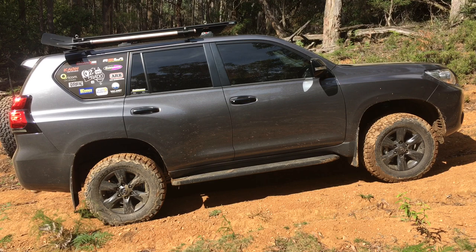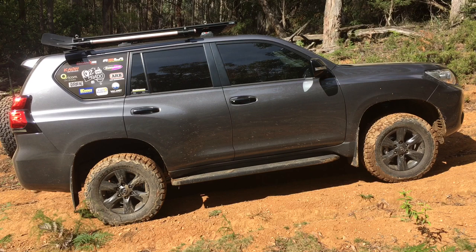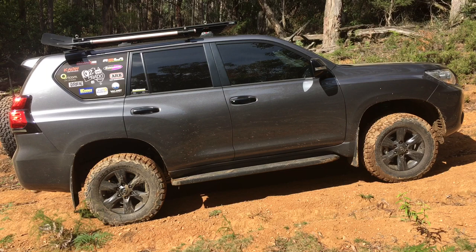So we've covered the front - it's comfortable. This is a 150 Prado with some 120 springs in it, because it hasn't got a bull bar and hasn't got a lot of weight at the front. We put the right springs for the vehicle - some 120s. We'd put 150 springs when it's really heavy at the front.